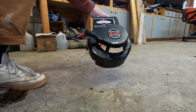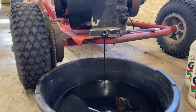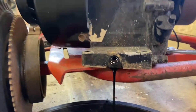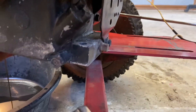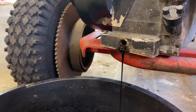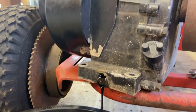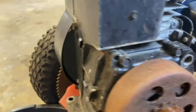There's nothing a lot of patience and a little WD-40 won't fix. I just pulled the oil drain plug — it's super easy on these. There's just one bolt there, actually one on this side too, so you can go from either side to get the oil drain plug off. It also has the oil fill on both sides too, depending on where your motor's mounted and what's more convenient.